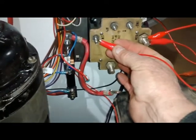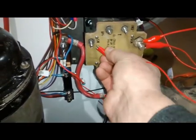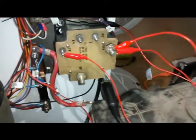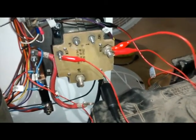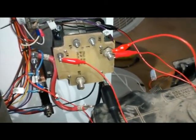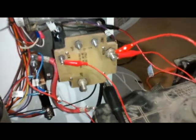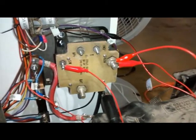I'll be quiet so you can hear the click — a very slight clicking sound. But it's not the big chunk that you're going to hear when this thing actually makes the connection between the two. That will not happen unless you apply a load on the battery side. You have to have some amperage draw in order for the reverse current relay to activate. In practice, when you're starting up the plane, you're draining the batteries a little with the starter and you've got electric fuel pumps on, so you will have some current draw at the battery terminal.